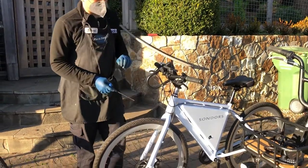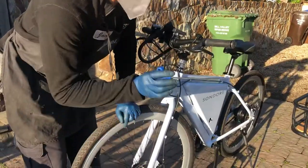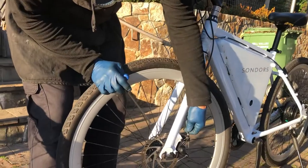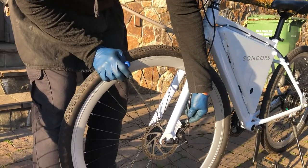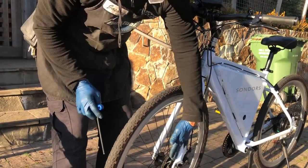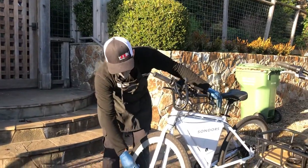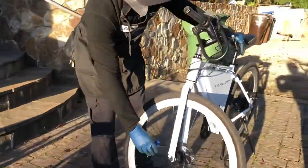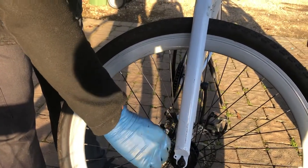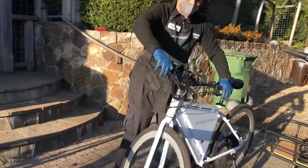On the Sondors, you can adjust at the brake lever, or you can turn the barrel adjuster on the caliper itself — that lengthens the housing and pulls the arm a bit more, bringing the outboard pad closer. When you're done with that, use the five-millimeter wrench again to turn the piston on this side. This one also has a click adjustment, though sometimes they don't have that.